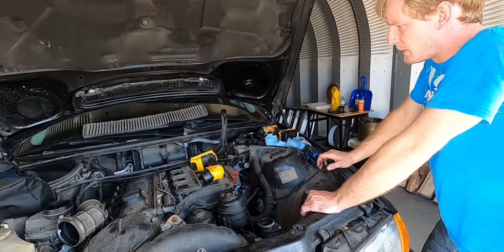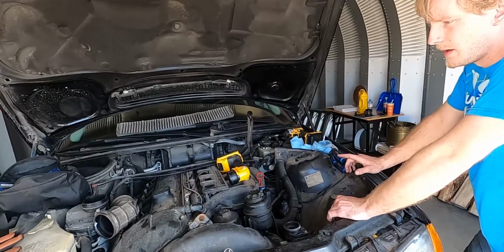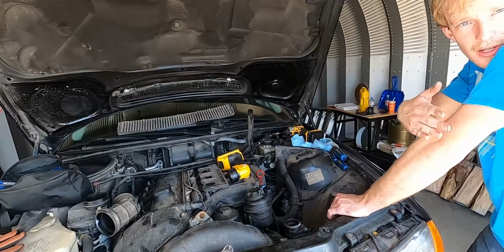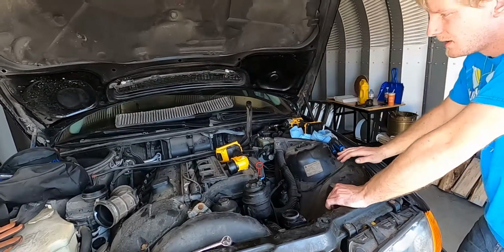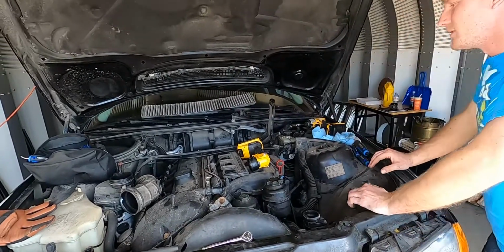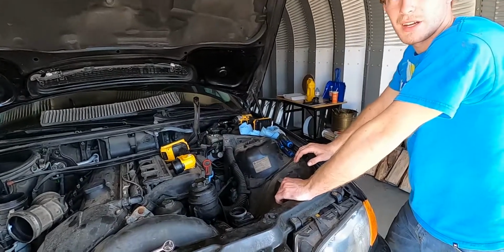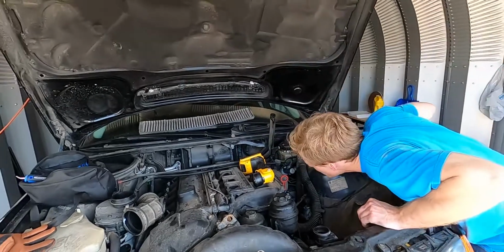But the next thing I would say, like, that seems pretty good. So the next thing is probably that there's a flap under the dash that will change from covering the heater core to covering the air intake. And if the flap is like the Mark II's, it's covered in foam, and the foam disintegrates and disappears, and then there's nothing directing the air. Yeah. So that could potentially be a problem.